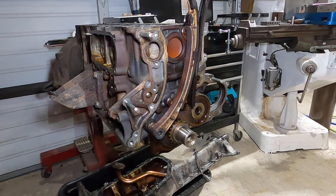Everything has looked really good as far as what's important to the build. On the next video I'll be taking the pistons out, connecting rods, and crank, and finishing removal of everything else on the block so it's ready to go get hot tanked. While the block is gone, I can start on the cylinder heads — I'd like to do some porting. We're going to port pretty big, get as much out of it as I can. I think it's going to be like two inches on the intake side and probably pretty close to that on the exhaust as well, though the exhaust will be kind of an oval shape.